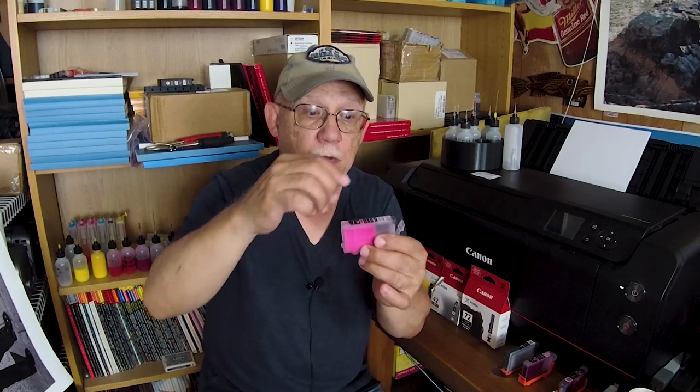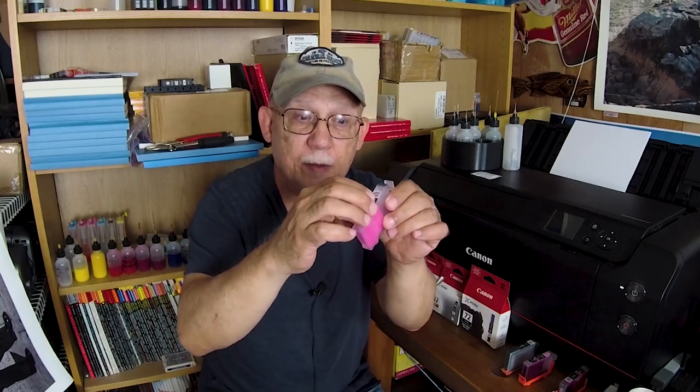You have to drill out that seat. All you're doing is drilling out the seat — not enlarging the inner diameter of the pre-existing factory hole. The most important part: you're only removing the seat, not tampering with the pristine plastic injection-molded surface. You drill out the bottom of that seat using a 5/32-inch diameter bit, which is actually slightly less diameter than the existing hole. That forces the plug to compress as it passes through the hole, then re-expand on the other side — creating a perfect seal.